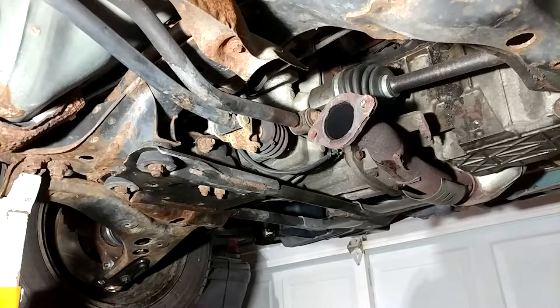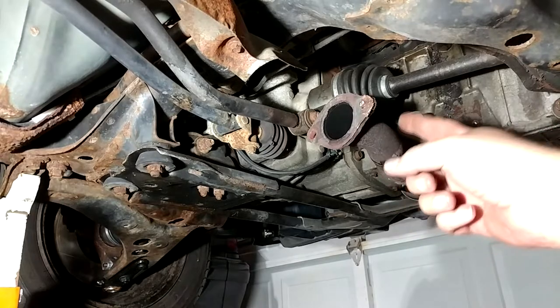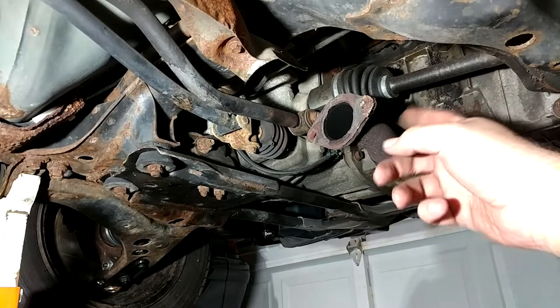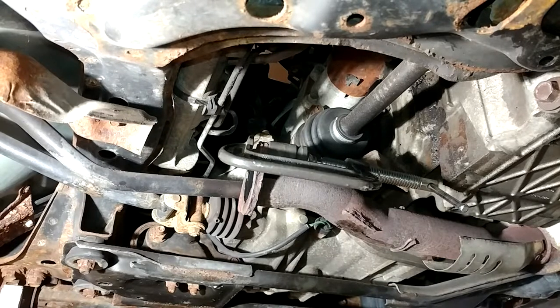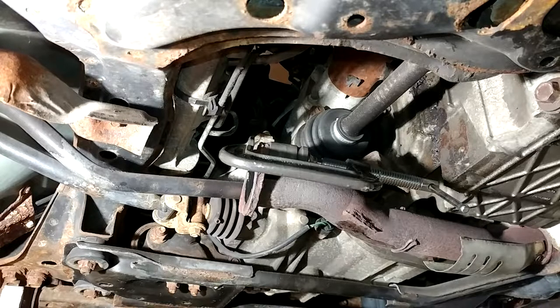As you may have seen coming, that front flange is in fact a complete nightmare. As you see it now, the flange is actually gone — it came off finally. What I ended up doing was grinding the head off the back of the other side of the bolt too, ground that guy down about half, and then the flange came off. But that nubbin of bolt is hopelessly stuck in there. So I'm going to try something that might seem dumb — a giant socket I'm using as a press die and a relatively small C-clamp as a press to see if I can just press that thing loose. I'm going to give this about a 40% success rate, but it's worth a shot.